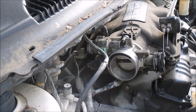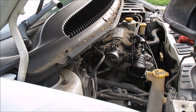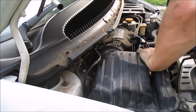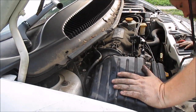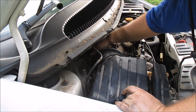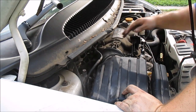I just got to put the box back in. There are studs sticking up — they snap in, but this part fits over the actual intake, so this gasket you want to push down. Make sure these clips are tight, which they are, so I'm going to throw this back in. Just had two studs to line up and then this thing bolts down. I've got to throw my intake clip back on — intake air temperature, all red clips snapped in. Should be good.